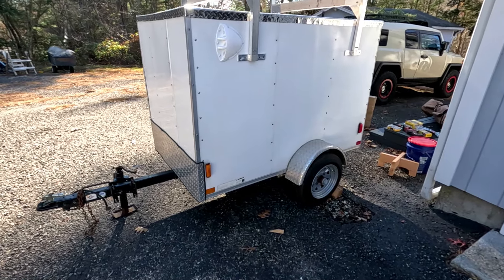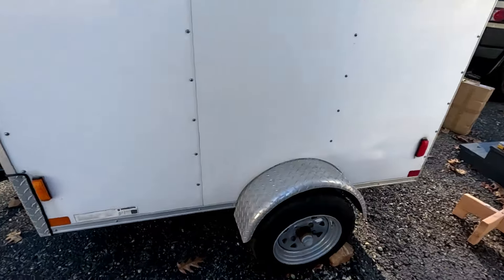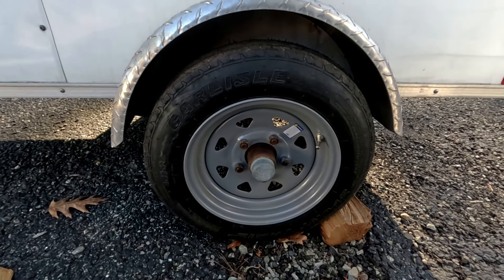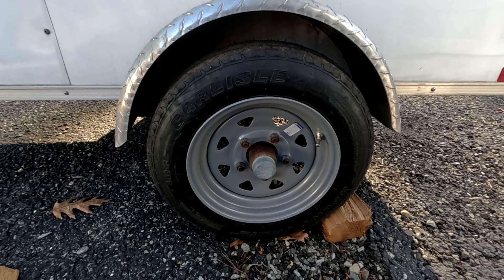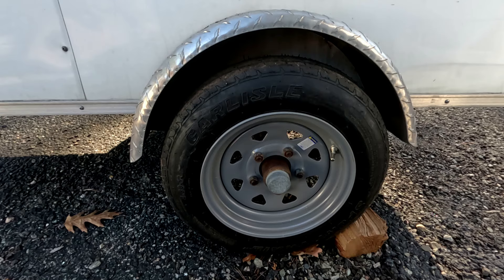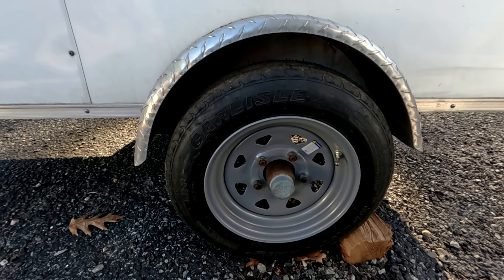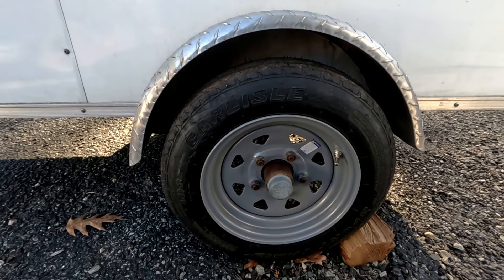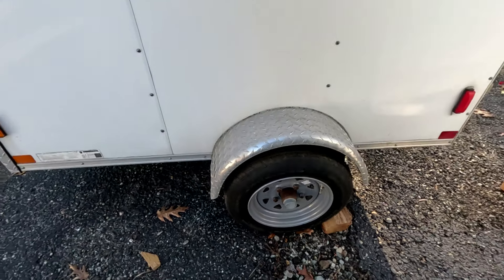Just to show you a couple of things I did: when we first got it, it had the original wheels on it, so I took those off. The tires had a lot of tread on them, but they had a lot of dry rot. So I ended up getting these new rims and tires — they're 480 by 12s, Carlisle Sport Trail tires. That way we don't have to worry about going down the road and getting a blowout.